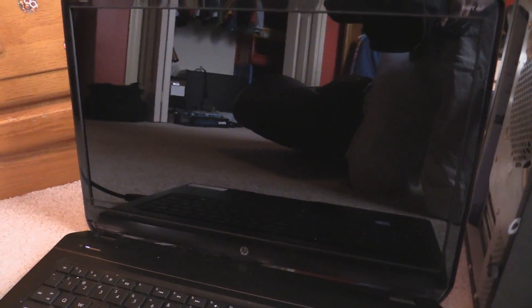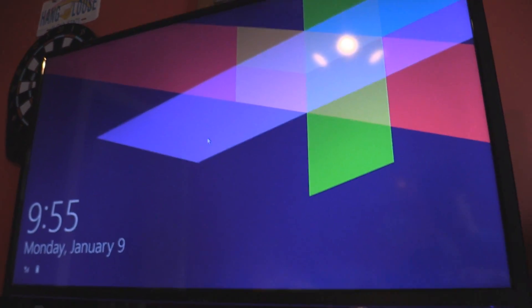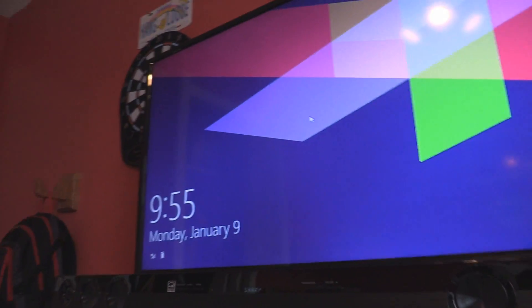Today I got a new issue on this laptop which doesn't have a backlight. I have it plugged in via HDMI here just to show that the graphics card is working inside the laptop. I'll go ahead and put a flashlight on — look, you can see the 9, you can see what time it is. So it's some sort of an issue with the backlight.